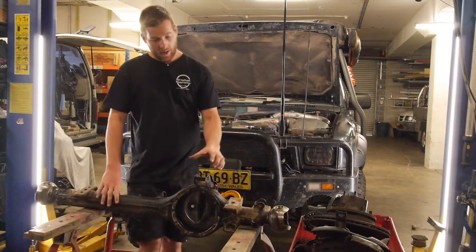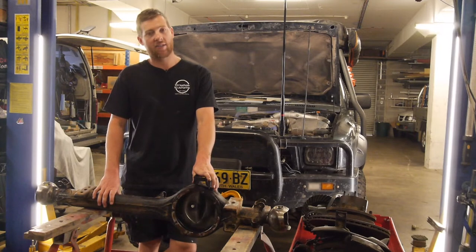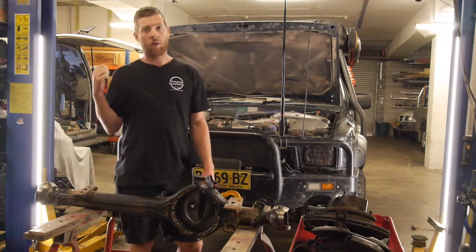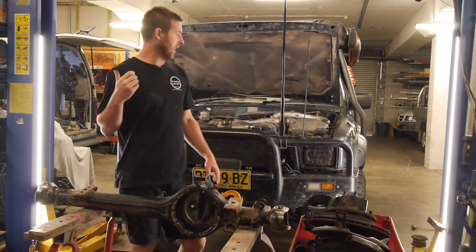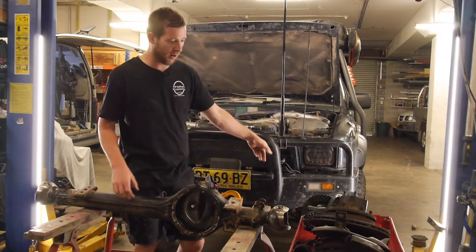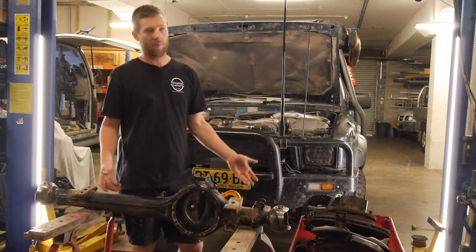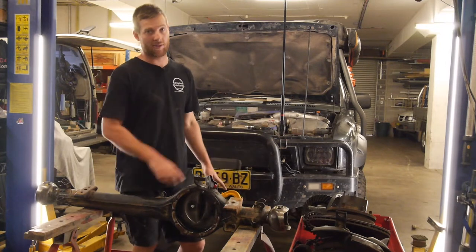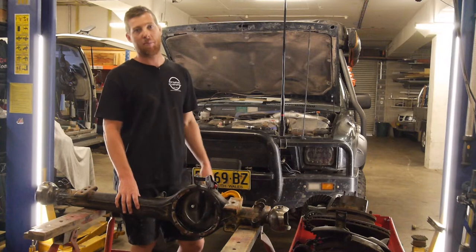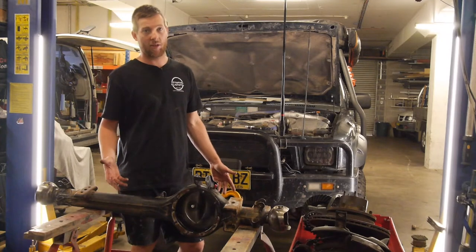I'm more of a tourer — I'd rather drive a hard track to get to an awesome spot. I do like doing hard tracks but couldn't really do them in the previous setup. Another pro for the front solid axle is it just cops the abuse a bit better than the IFS, especially this generation IFS. Thankfully I've got a wheel alignment machine, but after every single trip the alignment is smashed out, and I've noticed my idler arm — which is basically new — is already flogged out. When you're running big tires like 33s, everything's beefier and that force is amplified.